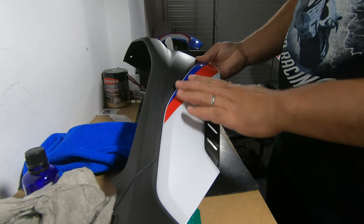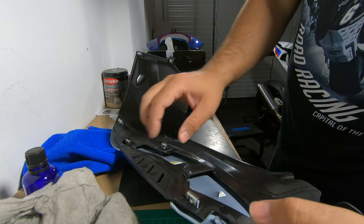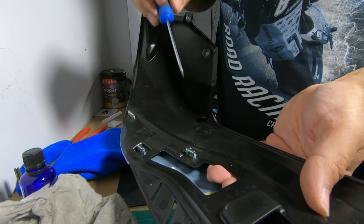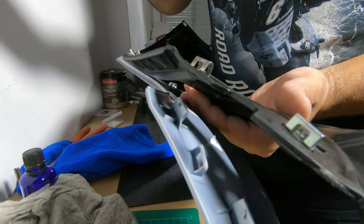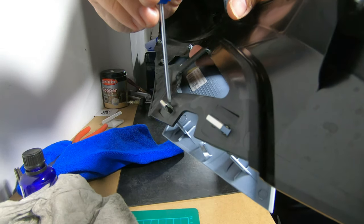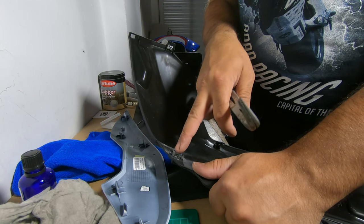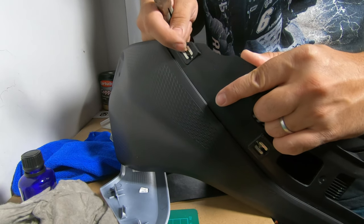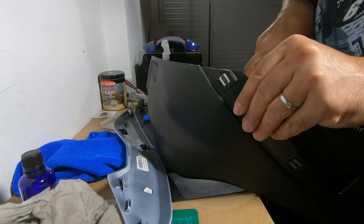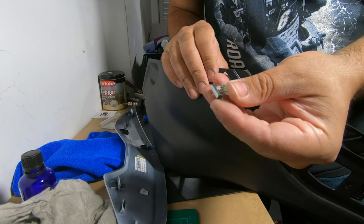On the side panel fairings, they've got these sections which we're going to need to take out and put onto the new section. They're just held in by little clips on the inside so they should just pop out. If you push from this side, just try and ease the clips out if you can. These are a pain in the arse — it's easy to put your fingers on and apply some pressure to these tabs and then just pop the screwdriver in and work the tab. There's a little catch under there. Get the screwdriver in inside there, pull the little lever back and just keep applying pressure to the outside unit. Eventually it just pops out. Now we need to remove these metal tabs and put them into the carbon fibre piece that we're replacing this plastic bit with. They're pushed through from the back — once you've removed the plastic, squeeze them together with a pair of pliers, they should pop through the front side. Just a bit of pressure, squeeze it together and you can take these little plastic clips out and put them into your carbon fibre piece.